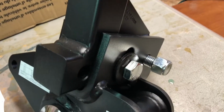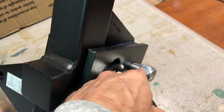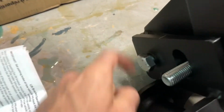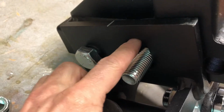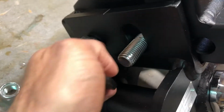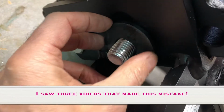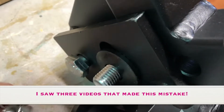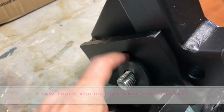Okay, I know if you're just following your nose, you're going to want to put one of these big washers here, like we just did. And you're going to want to put the other one maybe on the bottom, on this side, right down here. But that's not what happens. Goes up here. Why? Because this has a sliding slot where this can move, right? So it's very loose and open. So we need to cap that and also lock it in with those teeth that we talked about. Here, it's a very tight hole, so it's not a problem. All right. So be sure you get both washers on the top one.